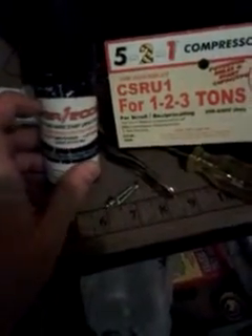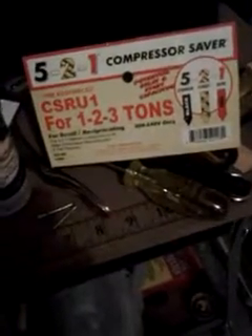Sometimes the relay will not engage if the compressor is starting very quickly after it's shut off, because the relay inside will still be hot and it will be open. Whereas with this particular type of start kit, the relay is a normal mechanical relay, so it opens given a certain potential, and then when it's out of circuit, it closes again. So it doesn't matter how many times you start the compressor or how much heat is involved — the start capacitor will always be in the circuit when it starts.